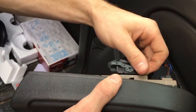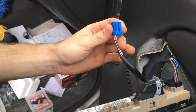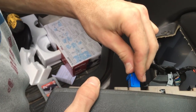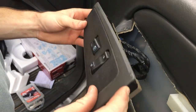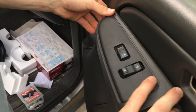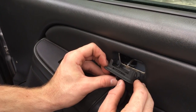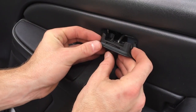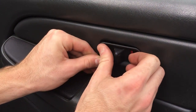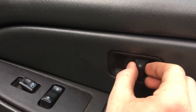Let's get these through. This stuff looks scary but it's really not. The black one goes at the top. This big gold one goes like this. And this blue one goes to the top. Now this actually broke on this particular vehicle, so it's kind of broken off there. You just go ahead and put it in and screw it on the other side. This is one of the hardest pieces to put back together. Easiest way to do it is to put it in the middle, line it up — there's a little groove — and then push it in. Make sure you can hear that click whenever you put it in; that's how you know it's in.